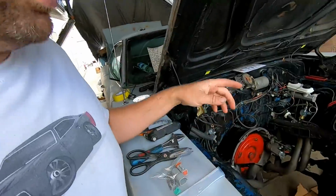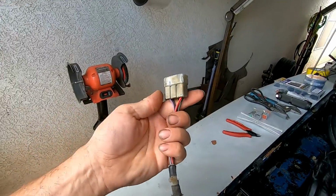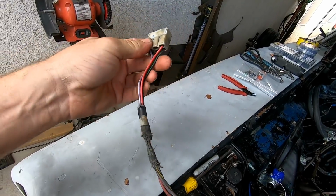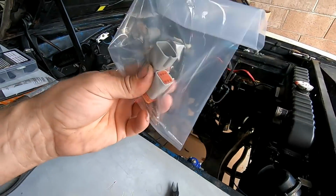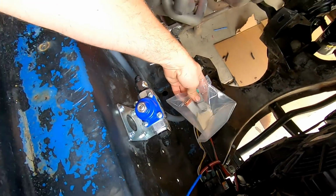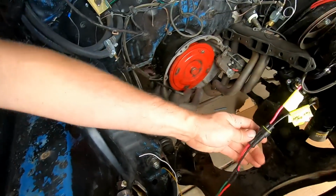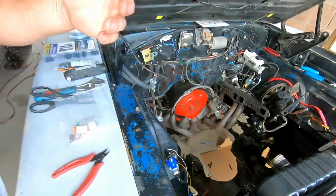And then we're also putting, like, see the, where's it at? I'll find it, okay, here. So here's the plug for the headlight harness. It's all brittle and breaking apart, and it's just not good contact. So the new harness, I'm putting a Deutsch connector. So this will be all waterproof, watertight. It'll be all down here, cleaned up. Same thing with all the trigger wires, this all has watertight connectors. So everything's being converted to better connectors.